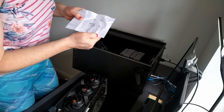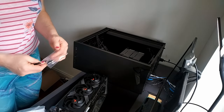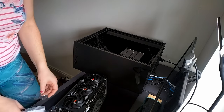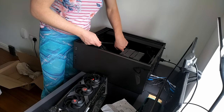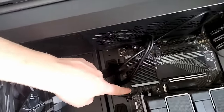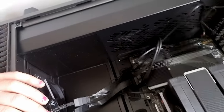Something like this — two screws. There are screws of different types but I didn't see how I would use them. It says it goes on the motherboard. I'm not sure if that's a great idea. If you look at the motherboard, there are these two screws here and here. I'm removing these screws — there is this standoff. I put them here. I'm going to put this rib on top of that, and then there is this blocking thing. This will hold the card from falling — that's the idea.